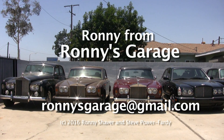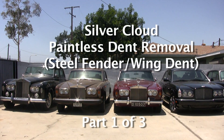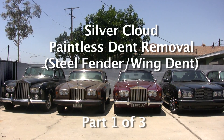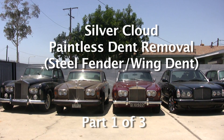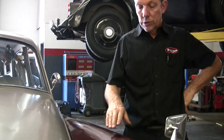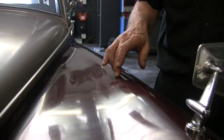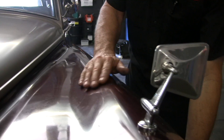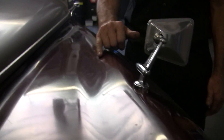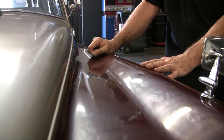Hi, I'm Ronnie from Ronnie's Garage. We hold monthly techniques at my shop and we have a misfortune here. One of our members had something fall down in the garage on the hood of his Silver Cloud 3, and as you can see there's a nice dent here. This is the fender — this is steel, this is thick, this is a high crown region. It's hard here and it's going to be difficult to reach, but a good paintless dent guy can take that out. They'll use a heat gun to warm it up so the paint doesn't crack, and hopefully we'll have great success.